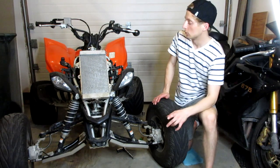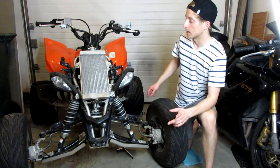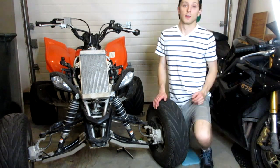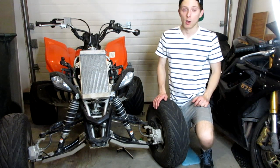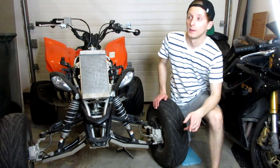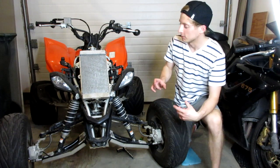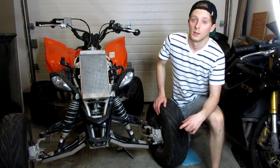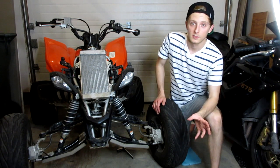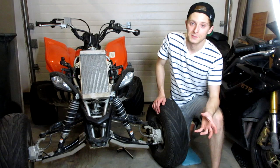One more reminder: after adjusting your valves, rotate your crank about ten times counterclockwise and recheck both exhaust valves, just like we did with the intake. The only thing left is to put the quad back together the way everything came off. I have to do that off camera — I'm on my last of three camera batteries after three hours of filming. If you have any comments or questions, leave them below. Hope you enjoyed this one — see you next Saturday.